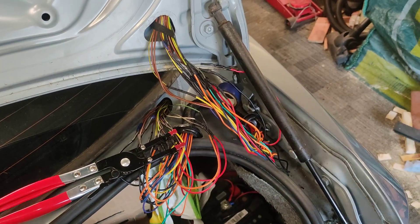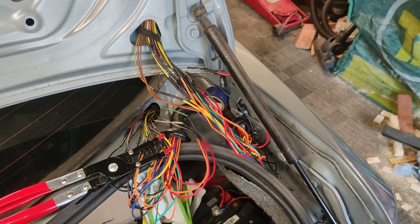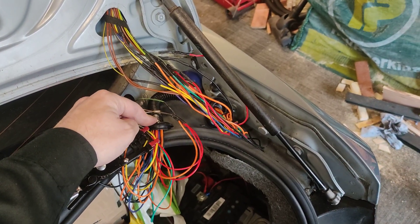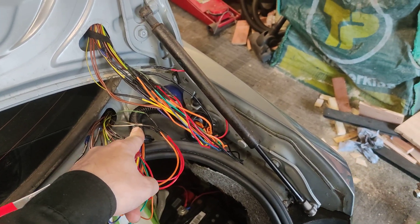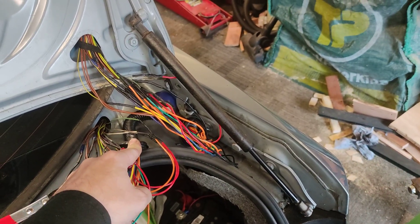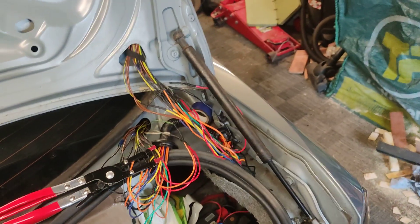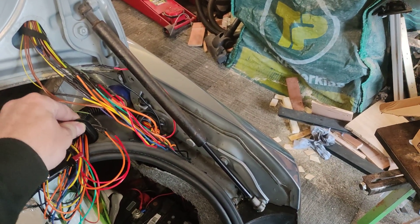There are probably a million different ways to do this, but I strongly recommend you get a repair loom. Or if you don't want to, you could get one of these rubber grommets and put wires through it yourself. I'd suggest getting a new grommet for two reasons: one, because the old one is old, and two, you don't want to be cutting all your wires and then threading new ones through your old grommet — you'll just get confused. So at minimum, buy a new rubber grommet.